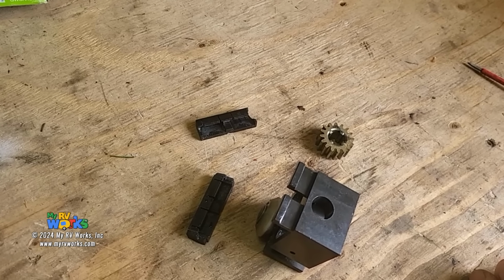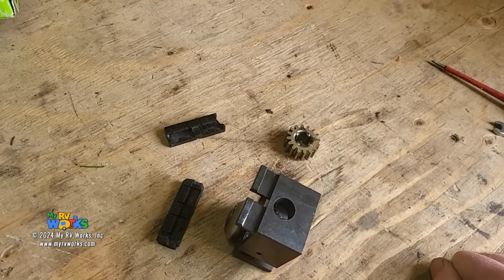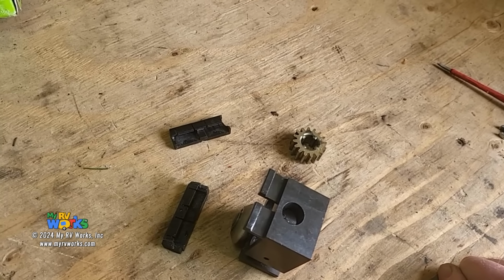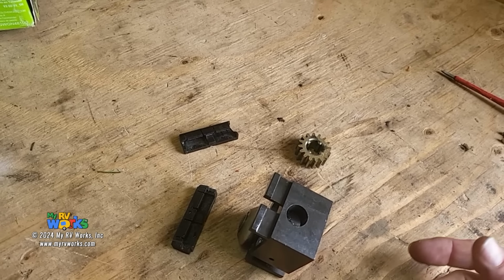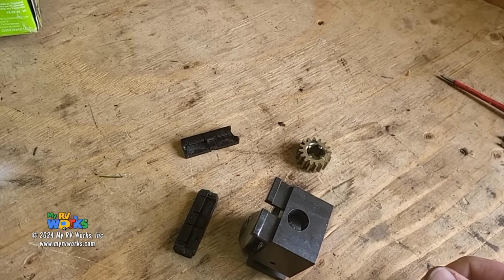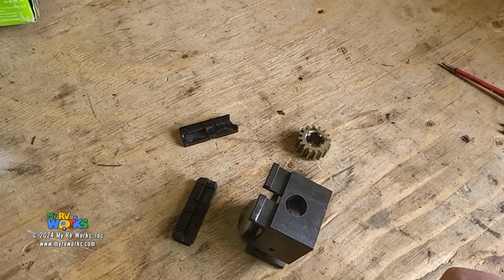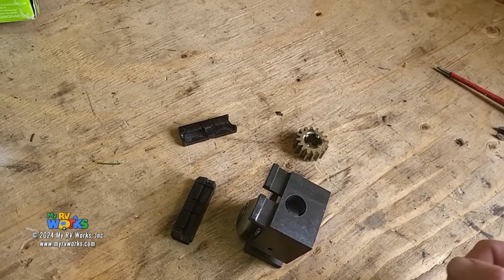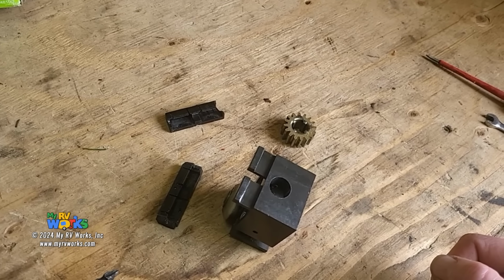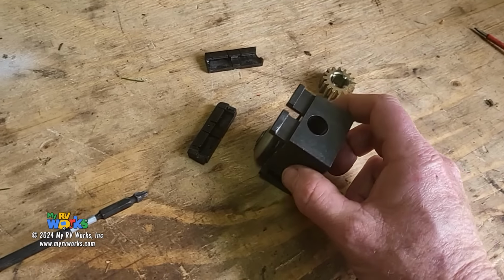Not because I make a lot of money making the repairs, but when it is working correctly, when it's all properly dialed in, when you've lubricated the rollers underneath, and you've got support underneath, and the weight of the room is on the rollers, this slide room will last you a long, long, long time. It's also very easy to work on. It's very easy to troubleshoot. It's very easy to recover from. And it even diagnoses itself with the control module. So they've done a fantastic job on the system. My position: lubricate it. Lubricate it with Teflon.